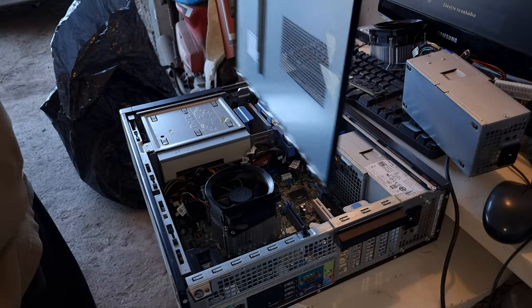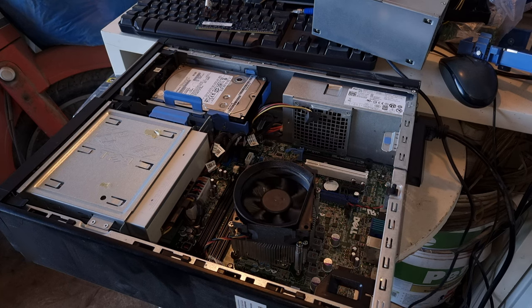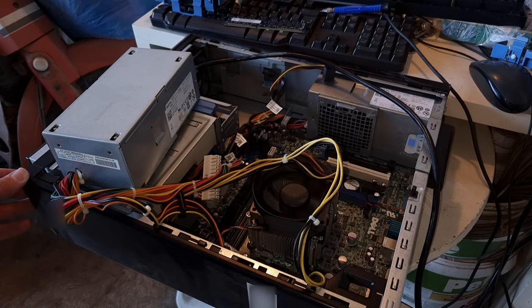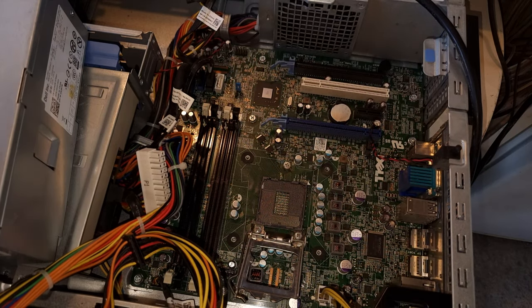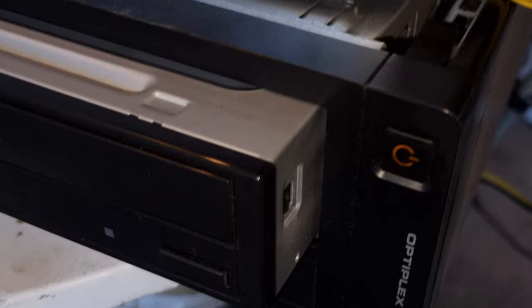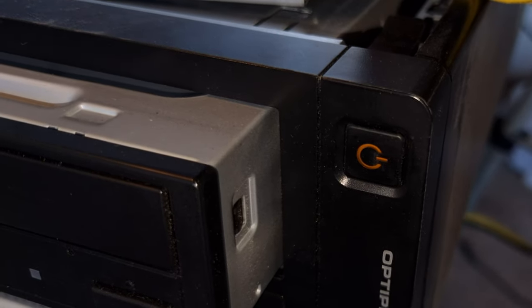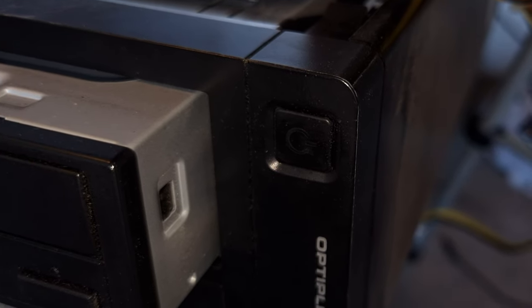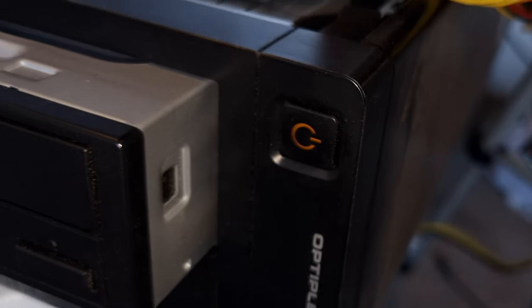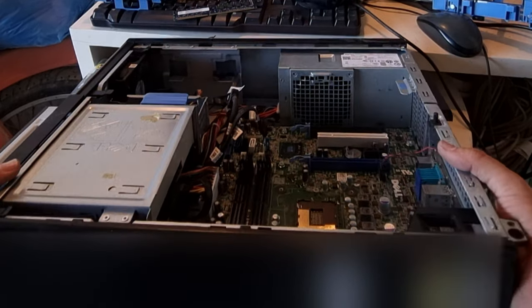Next up is the third unit, which didn't seem too promising because as soon as the power is on, it dies right away, and the same thing happens even with a spare power supply pulled from a broken dead unit with a fried board. Turns out the CPU had gotten fried, because when I replaced it with a spare one it worked, but no matter what I did it didn't proceed with the boot process at all. I believe the computer was hit by a power surge or simply fried itself for no reason, rendering it unusable, so this computer is getting sent to e-waste too.